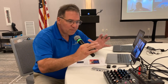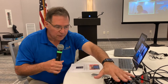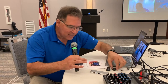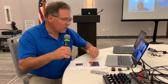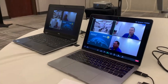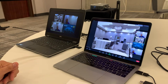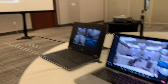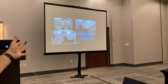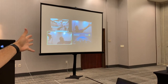This is the key part. This can be done for basically $100 to $150 worth of equipment to add — or if you already have a mixer, just adding the cables and adapters. The reason I have a second computer here is we've got the video going out of the second computer. I can have one computer on speaker view, and the room computer on gallery view, which means everybody in the room looking up there can see all the Zoom participants in gallery. If there are 25 people on Zoom, we can have 25 boxes up there.